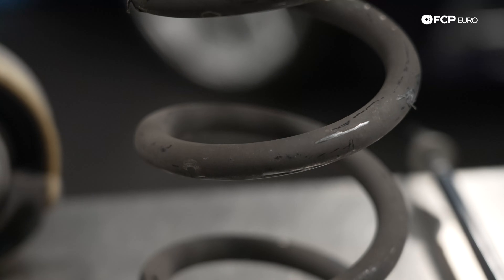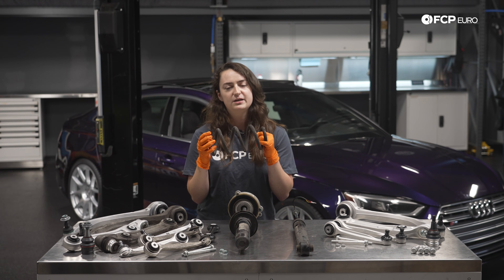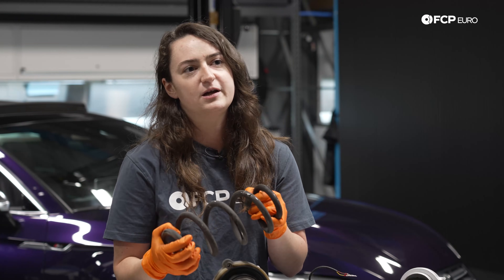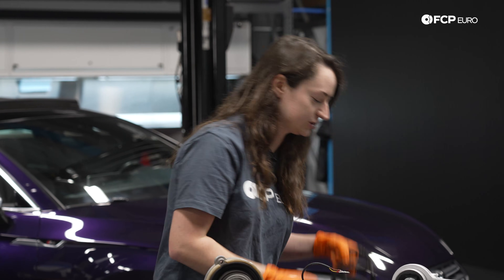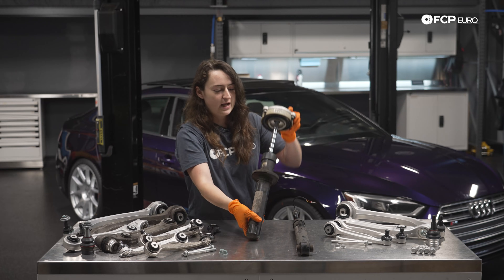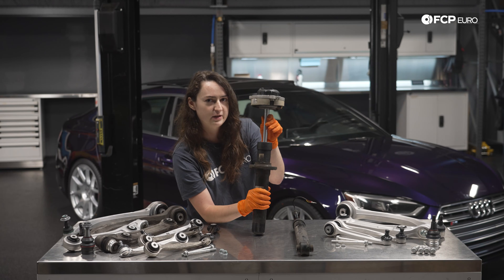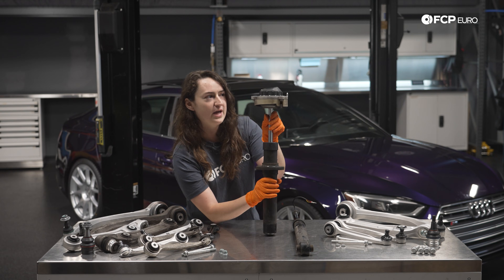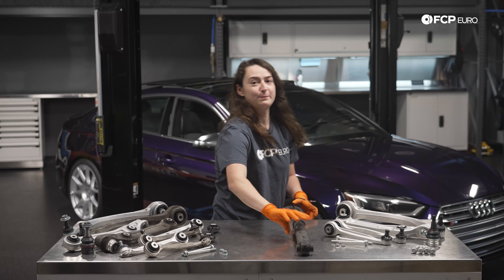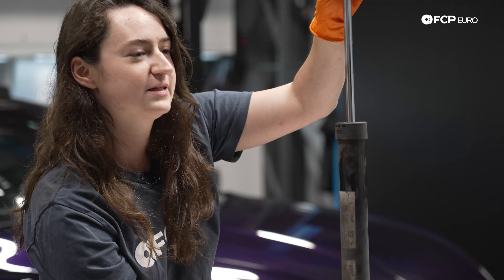Coils are fairly straightforward on these cars. There are some B9 cars that had springs that can shear or snap under certain loads; thankfully the B9 S4 and S5 doesn't have these issues. Other examples like Q5s may have had TSBs on this. However, if your car is equipped with DCC, such as our example here, you might see that these tend to fail. If you take a closer look at this strut, you can see there is some sludge and slime buildup — this is because the DCC strut has been leaking. You might not feel this right away, but you'll start to slowly feel it over time. A good indicator of a failing strut is that it's not returning back to height. When comparing this with the rear shock, I can't even compress this example down, showing that it is not leaking and it is still technically good.